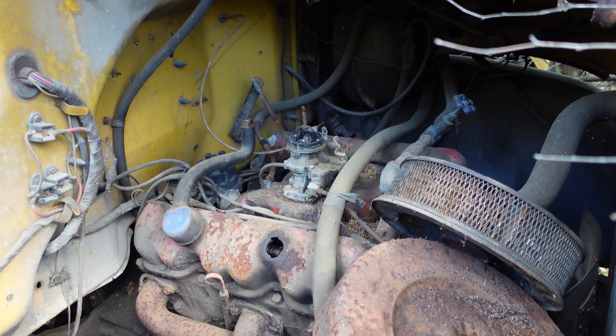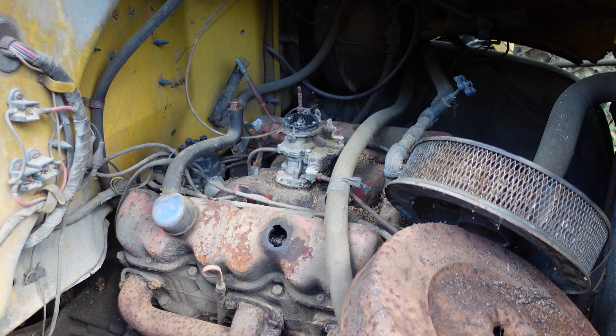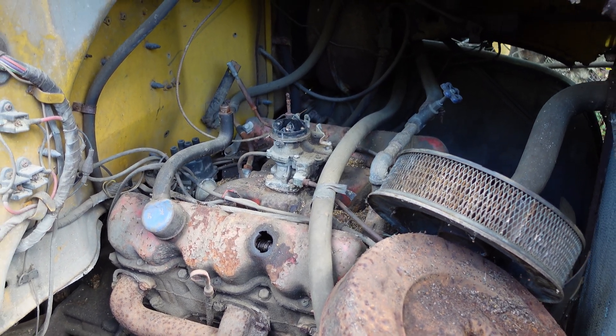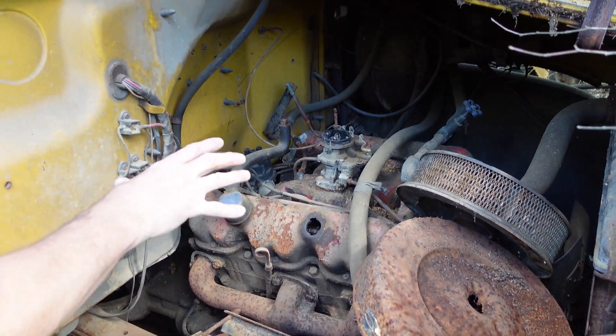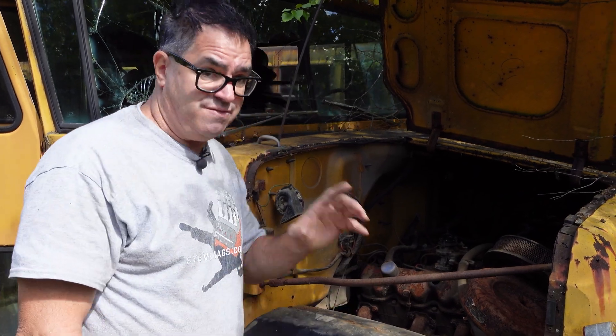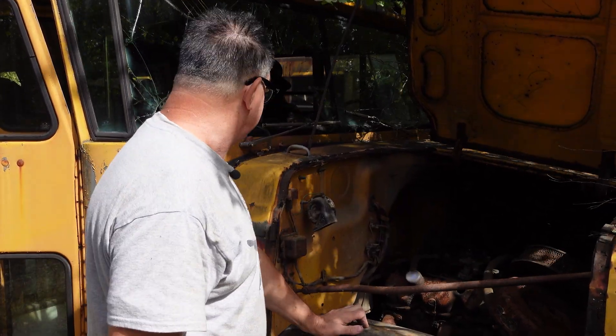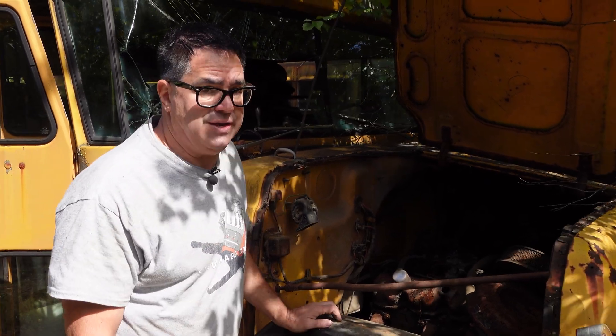And believe it or not, in heavy gas truck applications, the exhaust manifolds glow so hot they're almost orange, and they tend to melt plug wires. So, to have a shorter and heat-proof plug wire, the 60-degree engine family located the plugs up top — that's just some of the many weird things. These engines were built in 305, 351, 379, 401, 432, and even 478 cubic inches, and those are all V6s. There was also a V8 version, and even a V12 — the twin six — at 702 cubic inches.